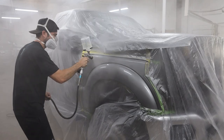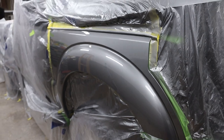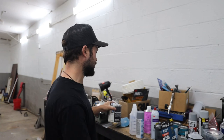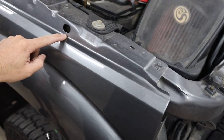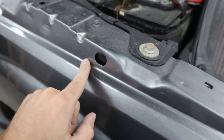Initially when we tried to run the paint edge in that body line seam, we were going to use 3M soft edge foam tape. I did use this on the top side of the fender just because I didn't want a hard line going into the part where the F-350 emblem is. I put a soft edge line just on the top of the fender and it worked out super good — you can't even see a line over there. The filler we used was Feather Fill with their hardener. Didn't use too much of it because everything was pretty good — just a couple of little low spots where we sanded down a bit more to get all the rust out, then glazed that over and we were done. You can see right here where I ran my soft edge along the backside. We could wet sand that just a smidge right there to get a little better, but you can't really feel it with your finger.